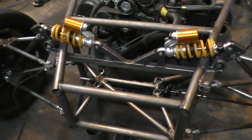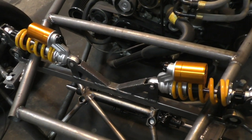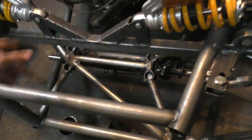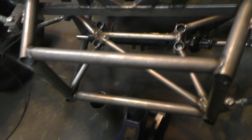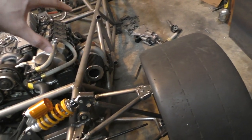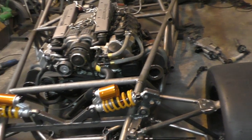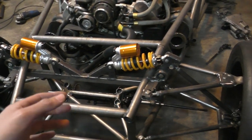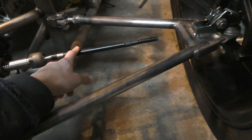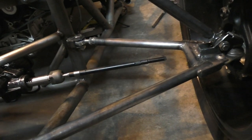I'm pretty much done mounting the steering rack but haven't completed the welding on the underside. I still have to add a few more braces on the front section for triangulating everything, including some cross members. My plan is to take this whole front part of the chassis off — it only has four bolts holding it — flip the whole thing over, make those cross members, and complete all the welding from underneath. For now I want to make my tie rod ends so I can connect the steering rack to the wheels and check how much bump steer there is.